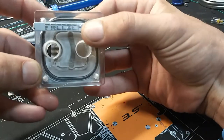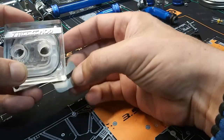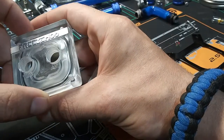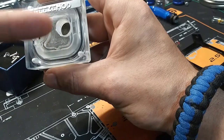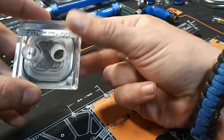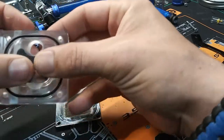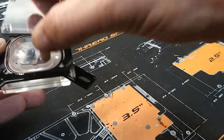Let's put it this way and look at it — can you see down the side there? The water will go in that way, hit the distribution plate, and then spread through the ports. If you ran it the other way, I mean I guess it doesn't really matter, but you don't want the flat part to run that way because the water is going to push against it and it's not going to flow properly. You definitely want the micro channels to be parallel with the holes in the block — that's a really good piece of advice.